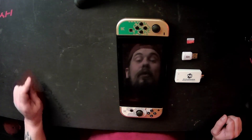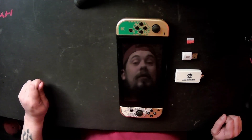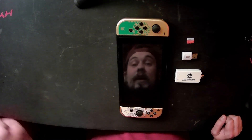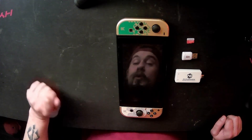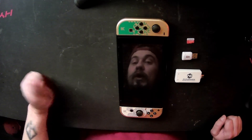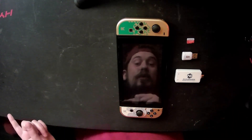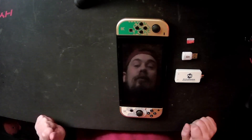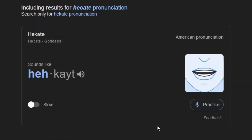On the software side of things, we're going to need: one, Hekate — the phenomenal aftermarket bootloader for the Nintendo Switch that lets you handle all sorts of things, from USB data transfer to just backing up your data. And two, the actual image of Ubuntu Jammy itself. I was going to do 24.04, but I've done this before, and when I was testing my 3D engine on 24.04 I got markedly worse results. It's been several months so it could potentially be better, but I just didn't want to deal with those dragons. Hekate — I've been saying that wrong for like seven years.